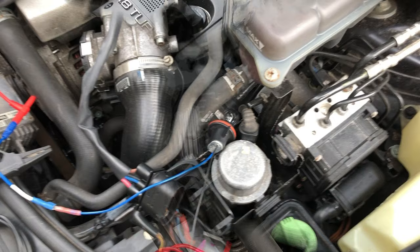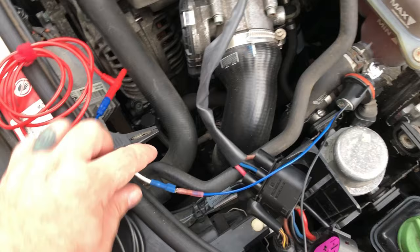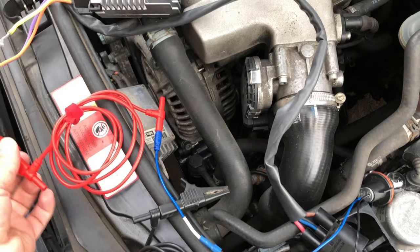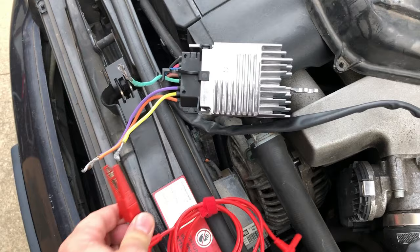What I have here is just a basic tail light bulb I saved from doing an old tail light job. I hooked up some spade connectors to it so I could adapt it to leads, and I have that with some leads from my AES wave breakout kit hooked to some wires. All I'm going to do is hook one lead to here, one to here — that should replace the load for the fan. We'll hook it up and plug it in.